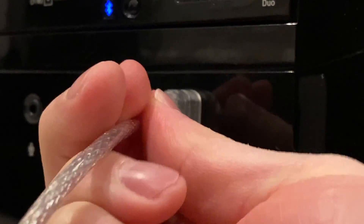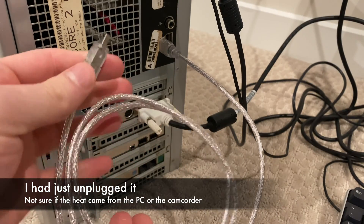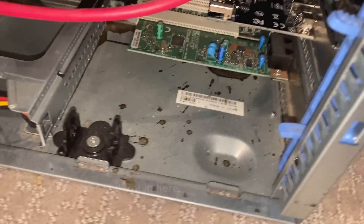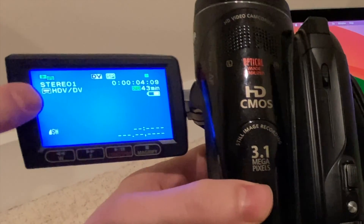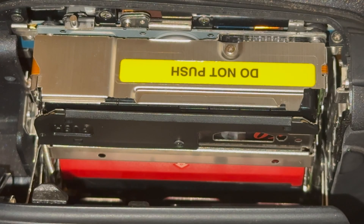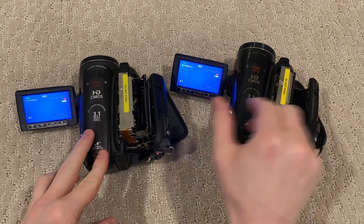The PC I bought has a 6-pin FireWire 400 port on both the front and back, so I started testing with these. I had success with the front port, but ran into issues when I tried the back port — I couldn't get it to work and noticed my cable was getting really hot. From that point forward, I could no longer get the FireWire connection to my camcorder to work, even when using a known good cable on a known good system. My hypothesis is that something was wrong with the back port that ended up short-circuiting something on the camcorder, or maybe the camcorder port was already on its way out. I ended up going on eBay and purchasing another camcorder just to finish this video, but when I received it there were clearly issues with the tape mechanism — it made grinding noises and immediately ejected any tape I loaded.